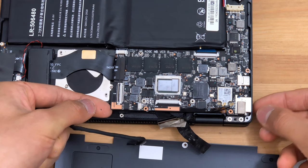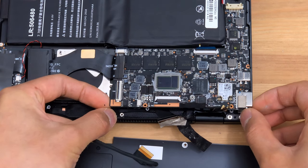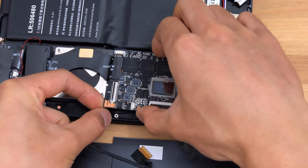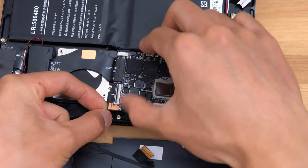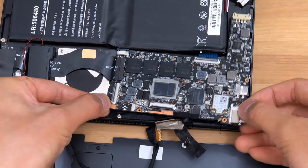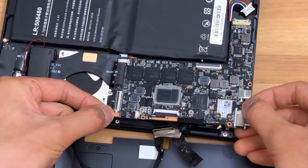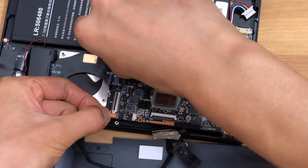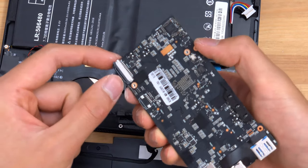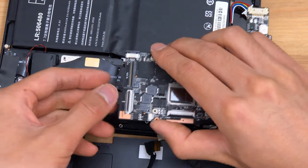That was a lucky guess — yes. We will push up on the USB-A connector and carefully free the motherboard, making sure all the flat flex connections have been disconnected. The battery should definitely come out first. If you were to attempt this yourself — this connector is for the keyboard backlight — and there's another connector underneath it, so definitely yes, the battery needs to come out first.